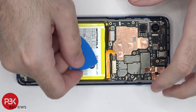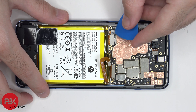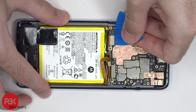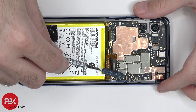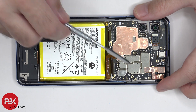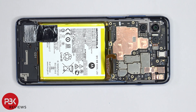Now the battery cable can be disconnected. Once the battery cable is disconnected, we can go ahead and disconnect the rest of the cables. This cable over here is for the fingerprint reader. Next, this would be the screen cable over here. And the flex cable over here connects your main board to the subboard. There are two wire cables in the corner which need to be popped off. There's copper tape covering the connector for the front-facing cameras — we're going to have to peel that off so we can disconnect the cable and remove the cameras.